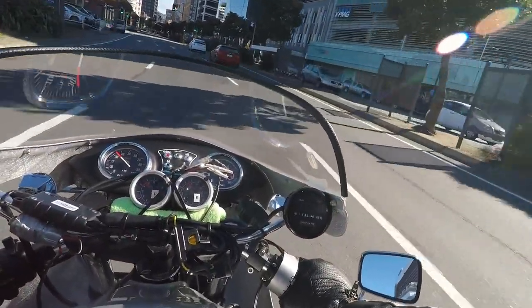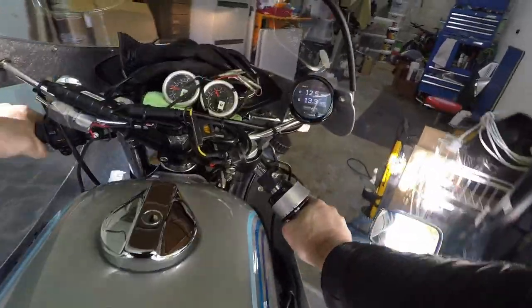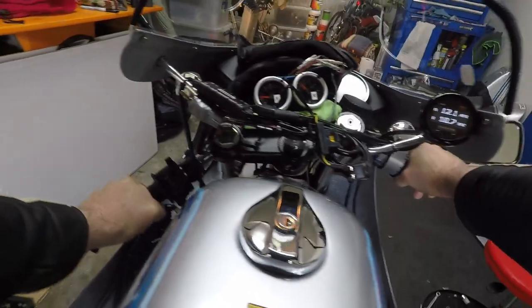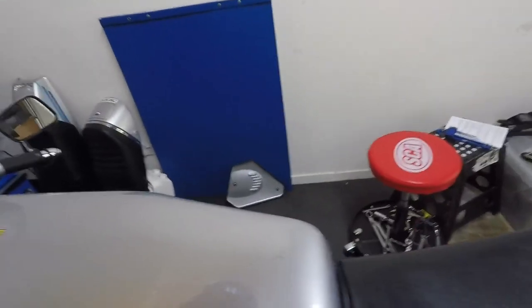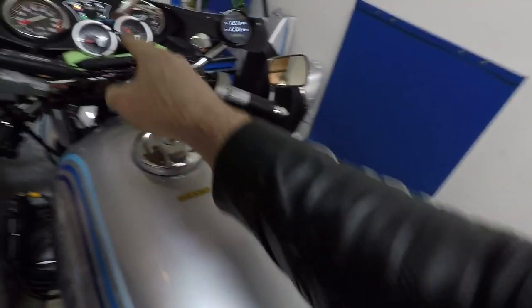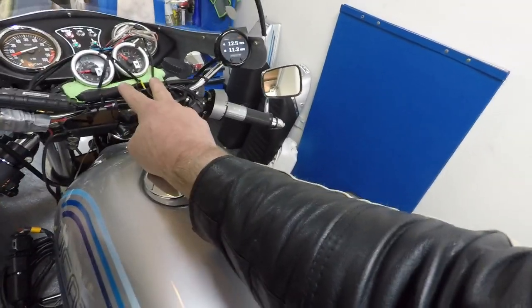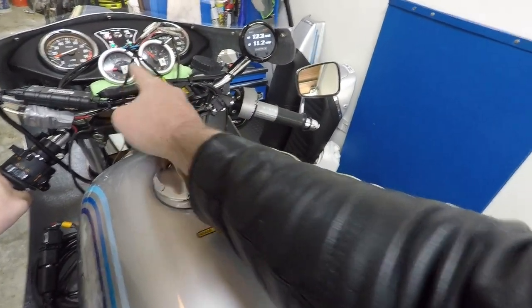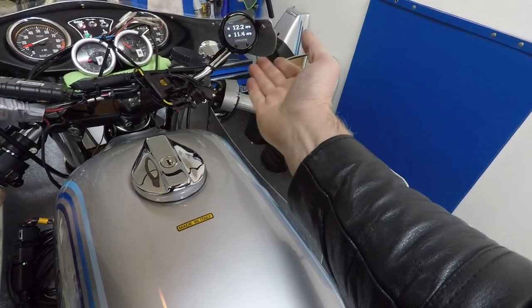Well, pretty nice. 300 on the front, 500 on the rear, upper. That's a big difference. 200 degrees. Yeah, 300, just over 500. It's 200 degrees difference. And the A is the one on the left. So that's leaner. 200 degrees difference and about 0.8 or so on average leaner.